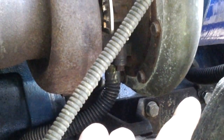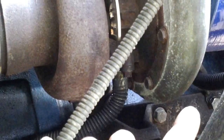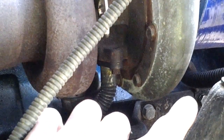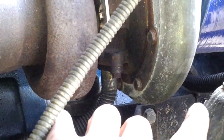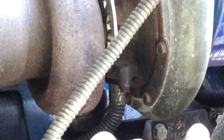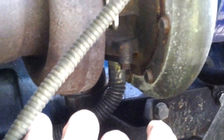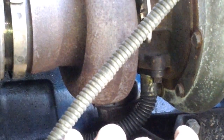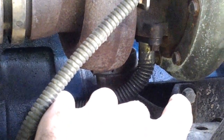What you do is you get a piece of 1/4-inch plate, you cut it to size. There are 4 bolt holes. You can only see 2 of them because they're hidden by the frame rails here. And the plate gets bolted through those to the block. And then this is where your motor mount is actually attached to the plate.